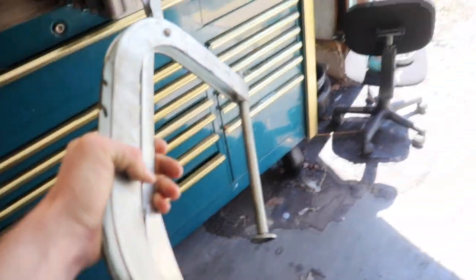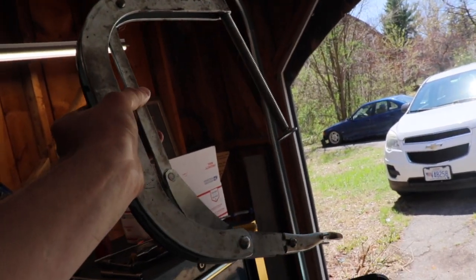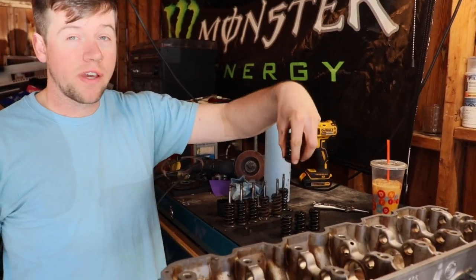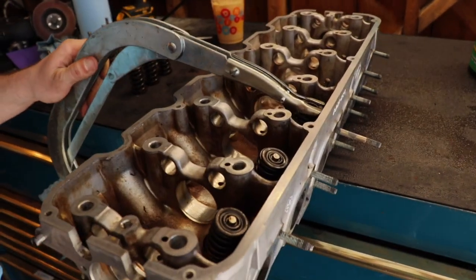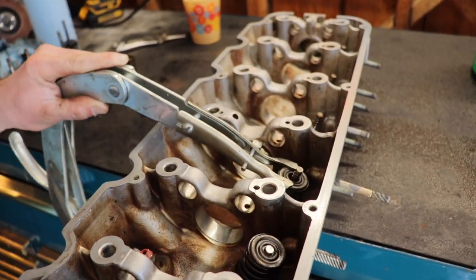Now I'm going to show you guys how to put in the valves. First you need to pet your dog. You grab one of these which is a valve spring compressor — you can find this tool in the description below, or you can steal it out of your dad's toolbox. We're going to grab our springs in the right order. I like to keep them in the same order as the valves. Put this over the valve stem, then take your giant C-clamp and put it on your spring. You want to line up the foot with the actual valve at the bottom and try not to score up your flat surface on the head. Then give it a good squeeze and it should lock in. Be careful you don't slide all the way off.